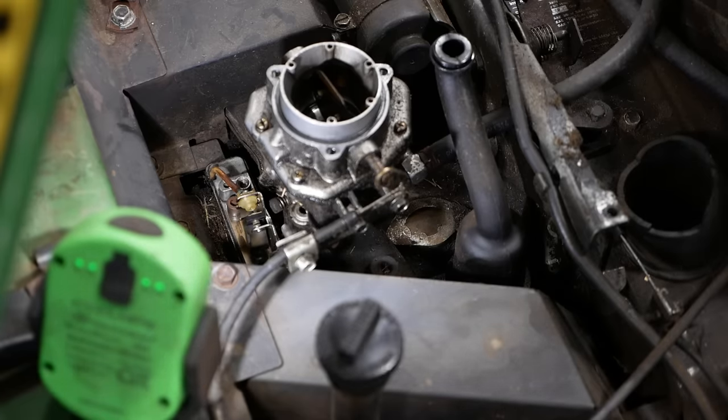I don't know what to say. It's not much of a video, I guess. The only problem I found is this glass fuse. Come on. Focus. Visually it looks fine, but for some reason it won't pass any current. I replaced it, and now it runs like a top. Let's see if it'll dry.